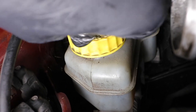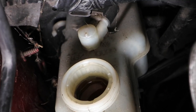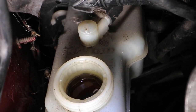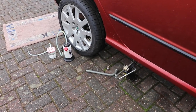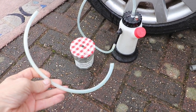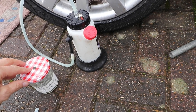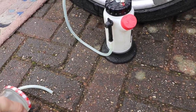The first method needs two people, so Billy No Mates is out of luck here. Use somebody that's either done it before, or somebody that can carry out instructions explicitly to the letter. Starting with the rear, I've jacked my car up a little bit just to give easier access to the bleed nipple. You want a short length of transparent pipe, approximately 8mm diameter, 5mm internal diameter, and a bottle of some kind. The most often used container is a cleaned-out jam jar with a hole in the top, but there are more professional bottles available.